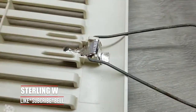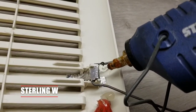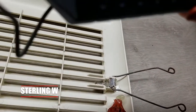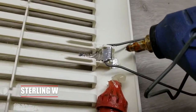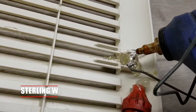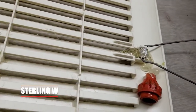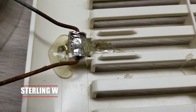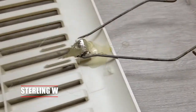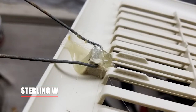Now that's done, let's go ahead and put the hot glue — oops, that just came off. This old Steiner hot glue gun has been with me for over 10 years and that top part keeps overheating and popping out. I'm probably going to fix that glue gun, but it's been with me over 10 to 15 years, so it's been pretty cool. I'm going to go ahead and give it some structure by putting the hot glue over the aluminum foil tape — it's going to act as a reinforcement. You don't really need a lot, just enough so none of the sides come off and it still moves. Hot glue is not touching the two metal springs. There you have it — that's already fixed. I've already fixed this like a couple of years ago and it still held up very well.